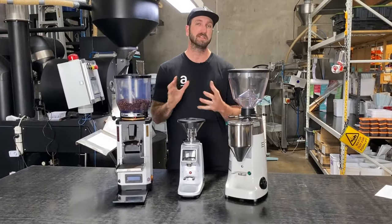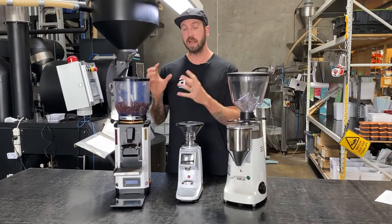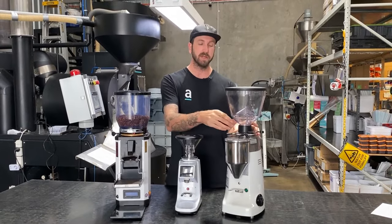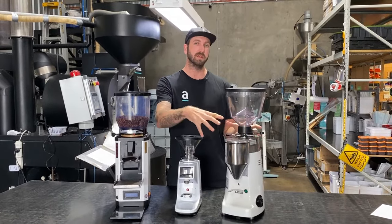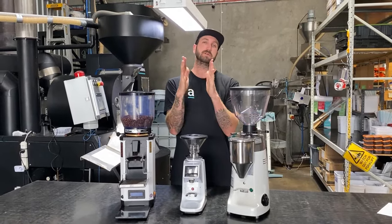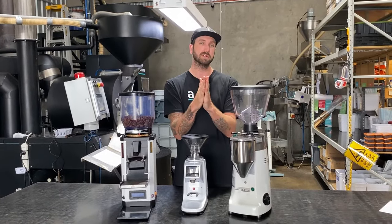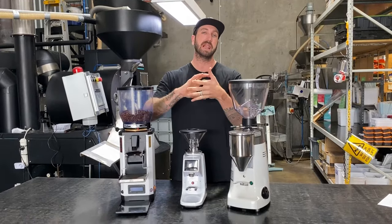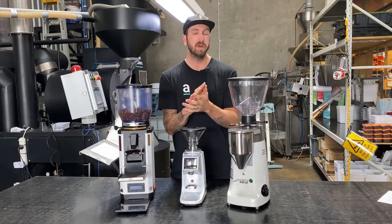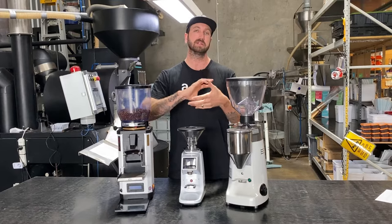Now if you've got this far and still no coffee, we can assume there's a foreign object like a rock or a large coffee bean, or your grind is simply too fine. What's happening is your burrs are very close together — the burrs might even be touching each other, which is worse — or there's something not allowing the motor to turn and cut through, whether it's a rock, a large bean, or too much ground coffee stuck in the burrs so they're unable to turn.